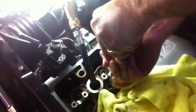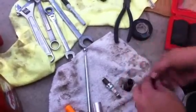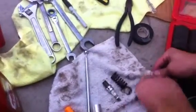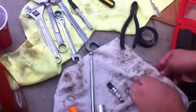The key here is to keep the tool completely square over the top. Then you want to slowly push down. A lot of times, depending on your mileage, this is really going to be stuck — that valve ain't going to want to move. Slowly lift it out. It's better to take the whole thing altogether so you don't drop a keeper. The last thing you want to do is go hunting for keepers, and doing it this way I haven't had to — knock on wood.